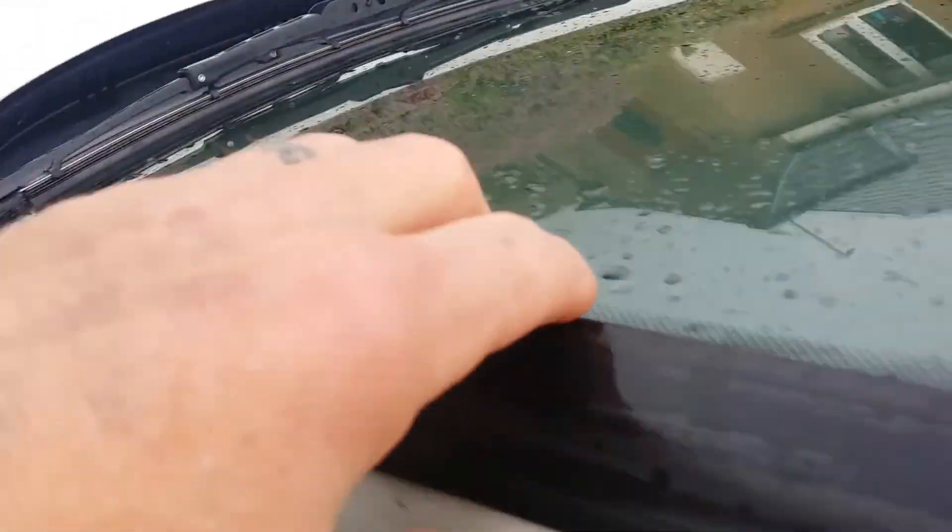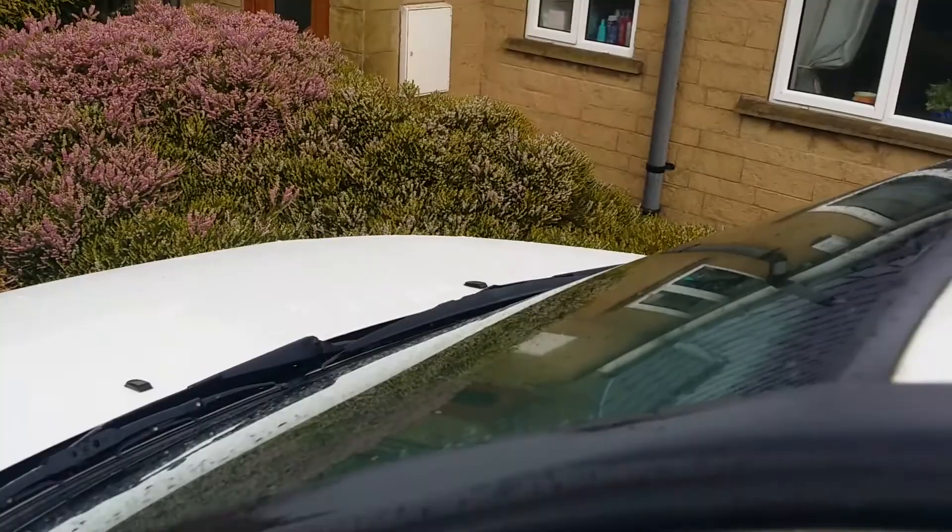It's probably a good idea to remove this top piece here that runs down, because you're going to need to see that there's no water coming down there — that's another favourite one. I can't see much at the minute but my floor is wet. Interestingly I've got no such issues on the driver's side; that's totally clear, dry as a bone. So you are going to be removing this entire gutter section all the way down here to get in behind there, and what you're going to find is loads of crud in there.